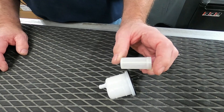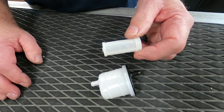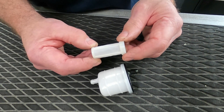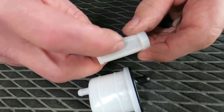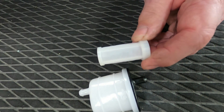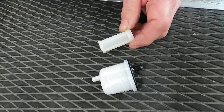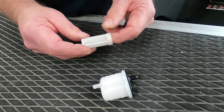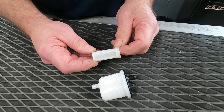I'm going to show you a fuel filter out of a Sea-Doo — I didn't want to cut up a brand new $30 Yamaha fuel filter to show you what's inside. This is exactly what's inside of it, and you can see it's a very fine screen — a plastic mesh-type screen — and it flows a lot more microns than the paper type. We're not in a dusty dirty environment. Hopefully you keep your gas cans clean and get good clean fuel, and this should be more than sufficient for filtering our fuel systems.